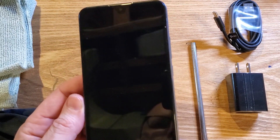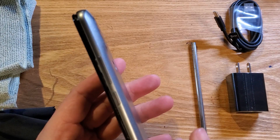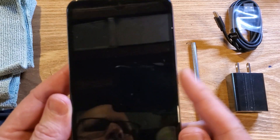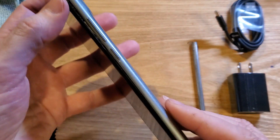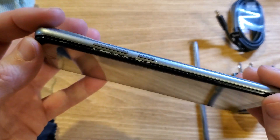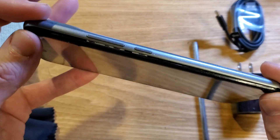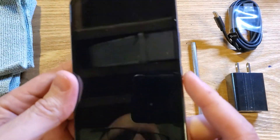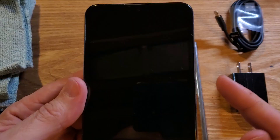The first thing is to make sure that your case has been clicked all the way in. I'm pushing the button here and the case is not clicked all the way in — it's kind of hard to tell. But if you've changed your SD card, your SIM chip, or your battery and you haven't clicked all the way in, you might have a problem getting your phone to power on. There we go — now it's on.